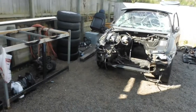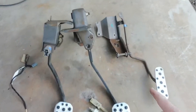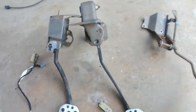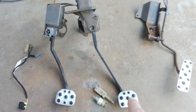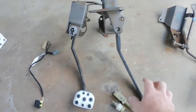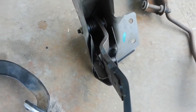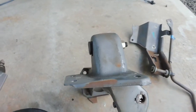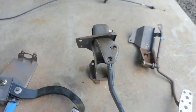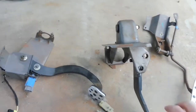This is what we've got that's come out of the wreck. I took the accelerator pedal - you don't need it, the only reason I took it is for this cover, so disregard that. Your standard V6 one will work. Obviously the brake pedal is a lot narrower, and you could just change the lever up in there with all the springs and washers, but in the situation with this up inside the car and this top bolt, it would be a nightmare. So it's definitely easier just to change this whole assembly.